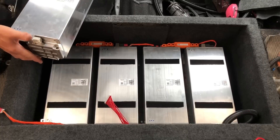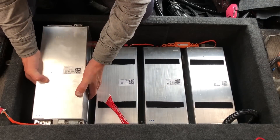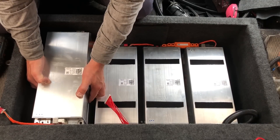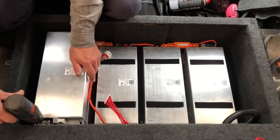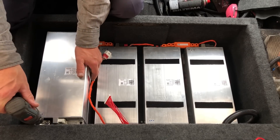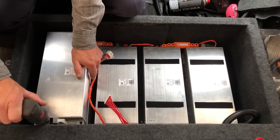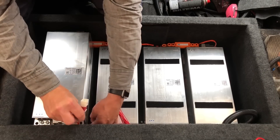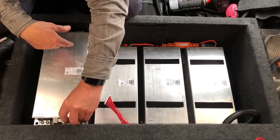This pack will have its own BMS — a 24S BMS. The other one will have a 12S BMS. Those battery modules will only be protected when I am charging them. When I am using the battery and driving, I will just shut everything down in time so I don't over-discharge the batteries.